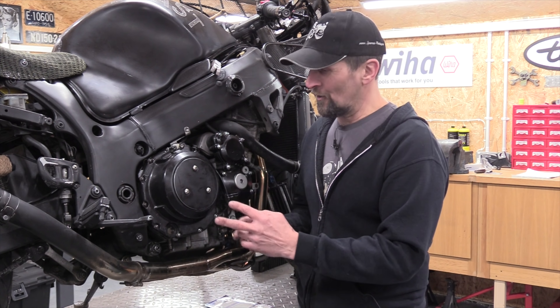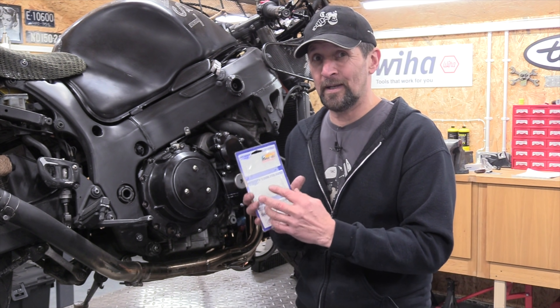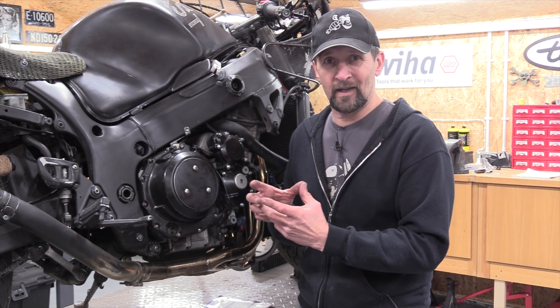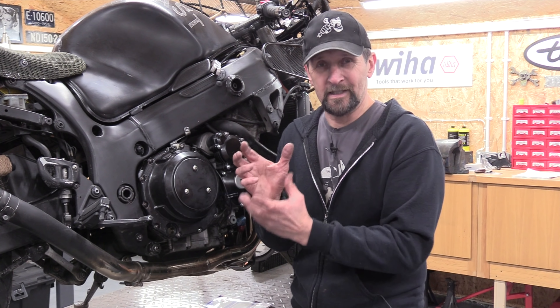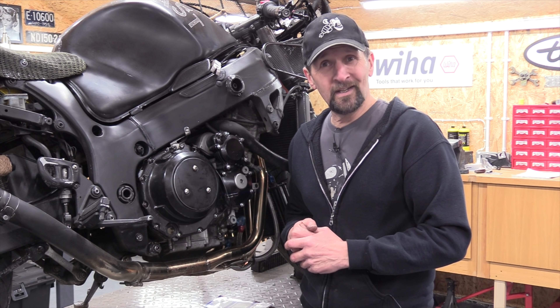These bikes have not just this as an inherent clutch problem but they also have a slave cylinder issue on the other side of the bike. The slave cylinder itself is mounted on a very thin cast aluminium casing and it just flexes all over the place — especially now I've put big fat hefty beefy springs in it as well. The six heavier springs come as part of the kit, all in at £85. In the next video I've got another kit that's going to bolt up that other side, lock it up solid on a brace plate. That's been the clutch mod — thank you for watching, take it easy, ride safe, I'll see you next time.